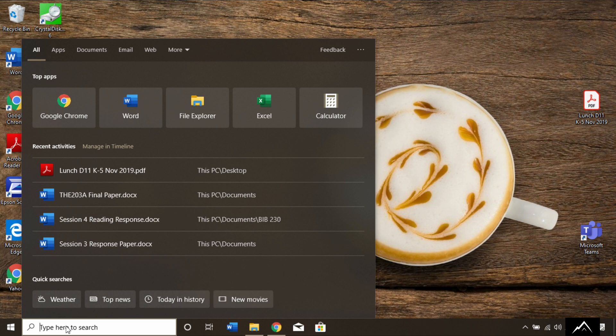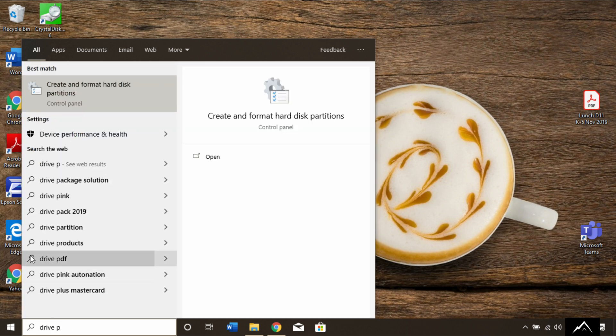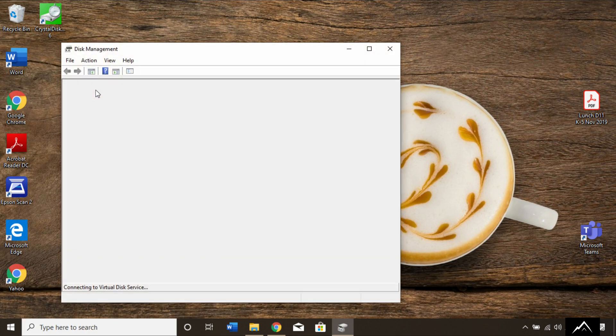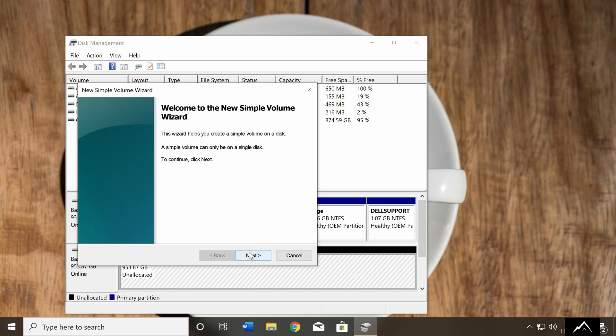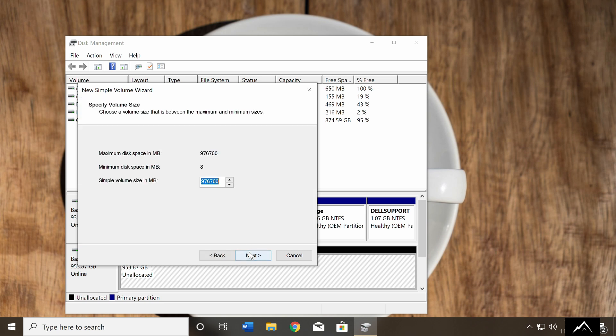What we need to do is initialize the disk so it can be detected by our Linux OS. Now we can do this in Windows or in Ubuntu, but you're probably most familiar with Windows. So let's launch the disk management utility — just type in disk management or drive partition in the search bar and it'll show up. Once it launches, it should automatically detect we have a drive that needs to be initialized. Select Master Boot Record as the partition style and click OK. Now you should have a new unallocated partition. If the format partition dialog pops up, you can select Do Not Format as all will be taken care of when you clone the drive.